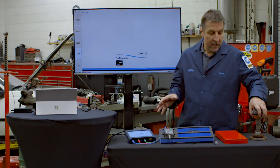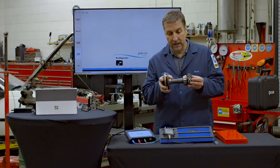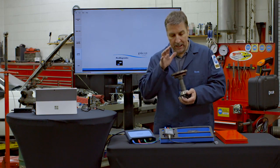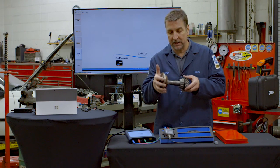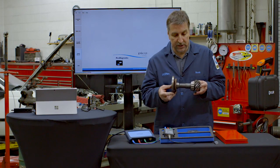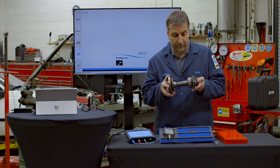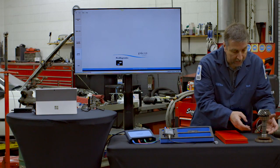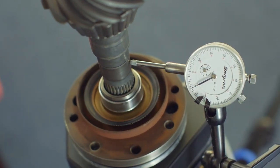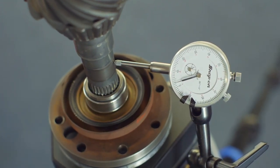To make a long story short, this vehicle actually had a bent pinion shaft — that was the problem. We're not sure when that occurred, whether it was induced by the original driveshaft failing or the other way around. I don't have a lathe here, so I sent the unit out to the machine shop. Our machinist reported 20 thousandths of runout. I was able to set it up on a turntable and zero out the edge of the companion flange to within about 2 thousandths, with about five or six thousandths of runout on the outer bearing surface.